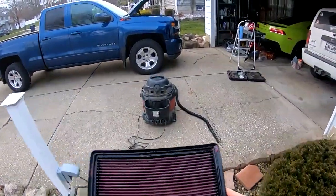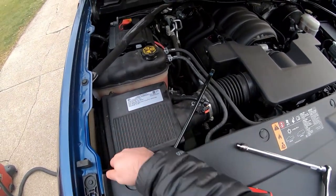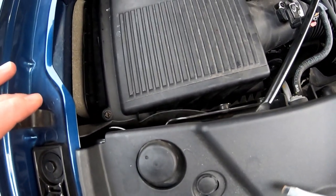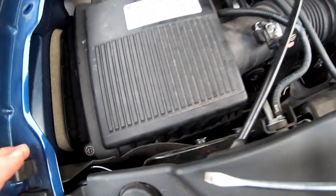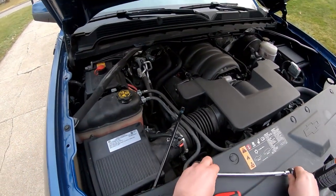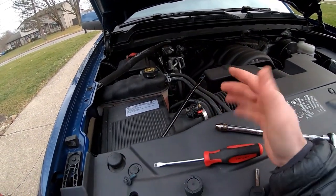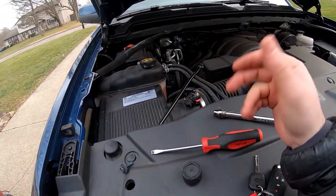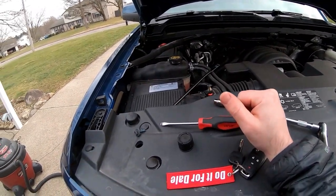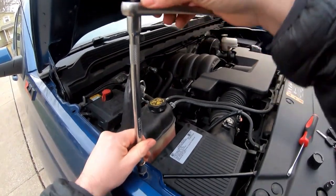Let's go up to the truck and throw it back in. Make sure it's seated properly all the way around, and just like that she is back together — all snug and secure, all four bolts. Food for thought: I used a flathead screwdriver for most of it, but looking at the head, it can actually be a Phillips head as well, or a 5/16 socket — worked out a lot faster. So if you wanted to, 5/16 is the way to go. The K&N insert says the filter should be cleaned approximately every 50,000 miles. My filter was only about 20,000 miles but here on Mooch Life we do things a little earlier so we can show you guys something cool and teach you how to take care of your car or truck.